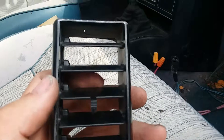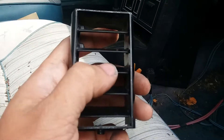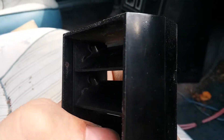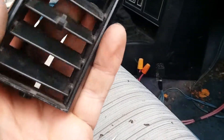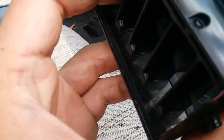If one of these is broken — meaning that out of this entire unit, just one of these vents is not moving when you try moving all of them up and down — on the ends of these there are three little pins. There's one in the center on each side, and there are two pins in the center, plus a pin on the bottom right corner of each of the louvers. Those pins go into the actuator arm, and that's what links all of them together.